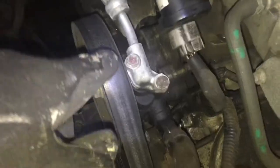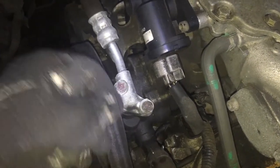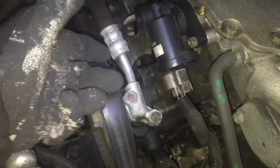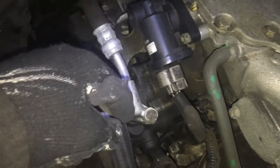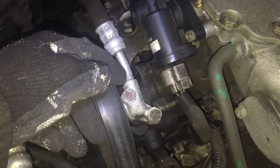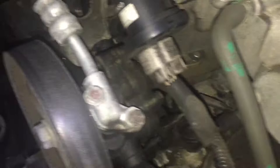What you want to do is remove this upper hose. There are two bolts here and one bolt underneath — both of them are 10mm metric. Remove the engine cover. You need to remove these 10mm metric bolts here, and while you remove the center bolts, you can pull up on the hose and you'll see a black or orange o-ring depending on whether it's been replaced. Underneath there's another 10mm metric bolt.